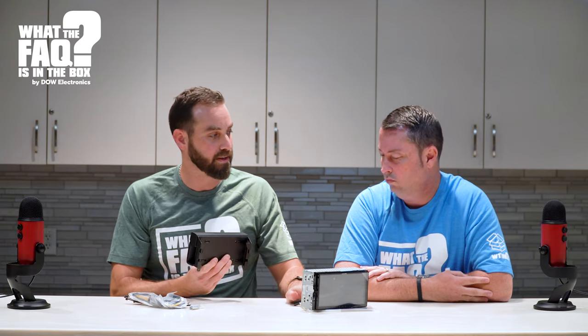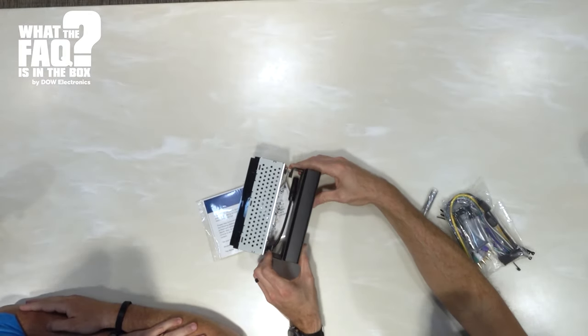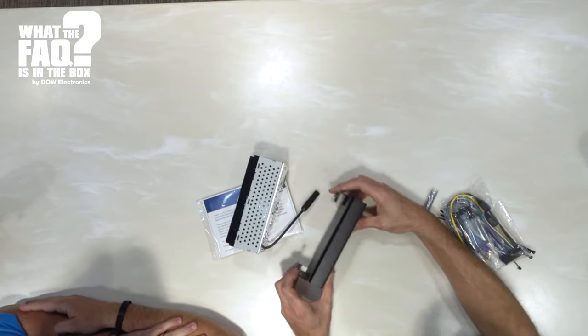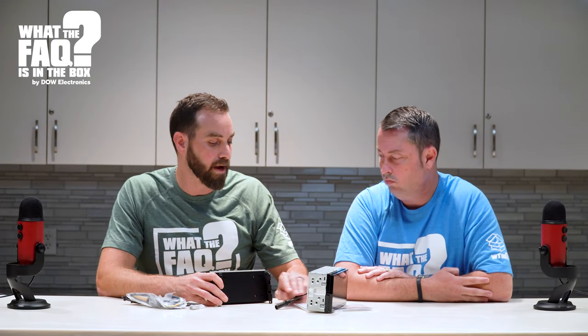With the depth, once you've got the amplifier, you're at the regular traditional double-DIN depth — but you're getting real performance with a real amplifier behind it. What's really nice is they give you just a little bit of space to get the cables you need from the back of the radio. This bracket keeps it about three-quarters of an inch off the radio, which allows you to get your USB cable, pre-outs, harnesses — so you won't have to bend those cables. Really well-thought-through brackets.